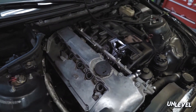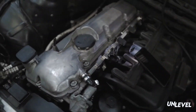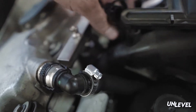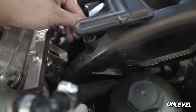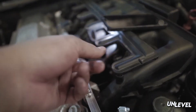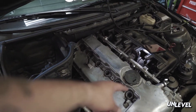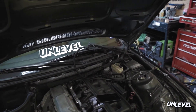Basically done. I used an adapter here to fit the M56 piece right to the hose, then used the old M54 one, and capped off this tube. Now it should just click into place — and there we go. I'm gonna get a real vacuum cap, but for now the vacuum should pull that cap in so it won't go anywhere. Now I just need to torque all these down and get the harness back in.